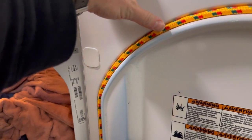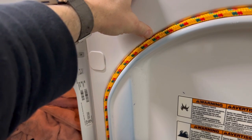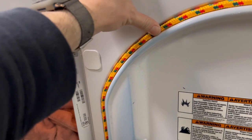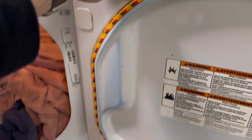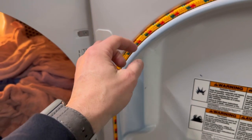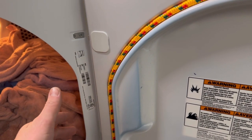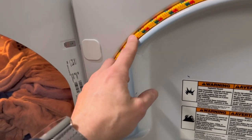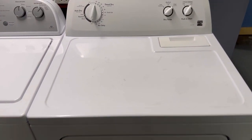Lots of heat coming out of that tube. The air coming out heats the inside of your dryer anywhere from 95 up to 195 degrees, depending on how long it's been running and what heat setting you use — and you can see the huge capacity. I'll note that I replaced the drum seal here with a high-temp nylon rope glued in with oven adhesive, so it's not coming out. It blocks the airflow, and I've been using these for years. If you ever need to replace yours, it's a great tip — super cheap, available at Lowe's. I don't like the expensive oven kits or the cheap Amazon kits. I've been using this method for six or seven years — they don't fray, don't come out, the heat doesn't affect them, and they do an excellent job sealing up. This one's just a little festive in color.